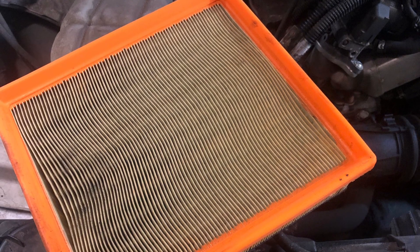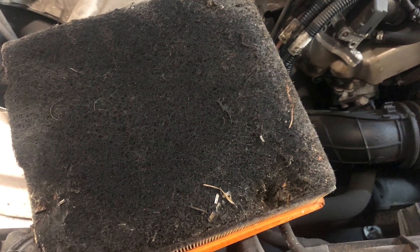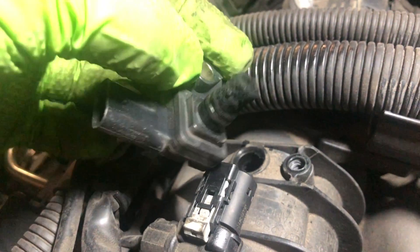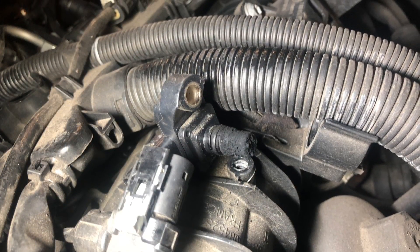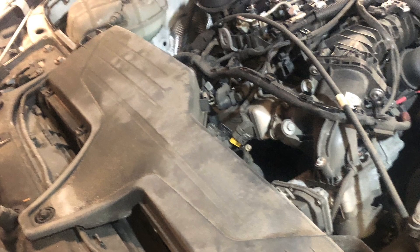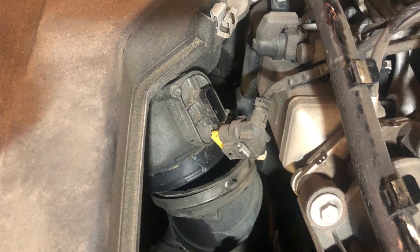First, let's start by just checking the air filter — this could be blocked or clogged. More importantly, we're going to check the mass airflow sensor. This is very easy to remove, and what you see may shock you. It could be built up with carbon deposits like this. If it is, you will need to remove the throttle body, and afterwards we'll remove the inlet manifold.